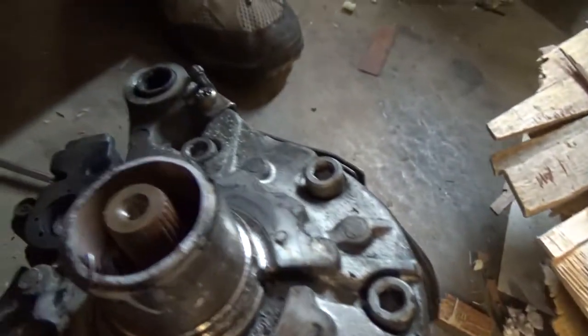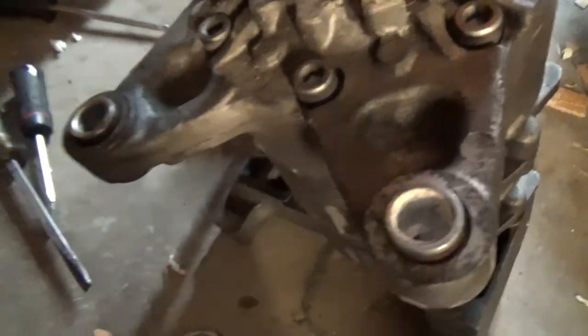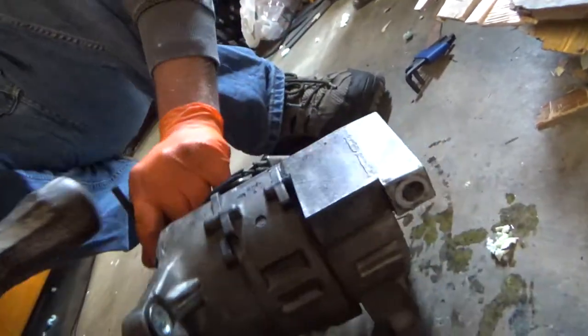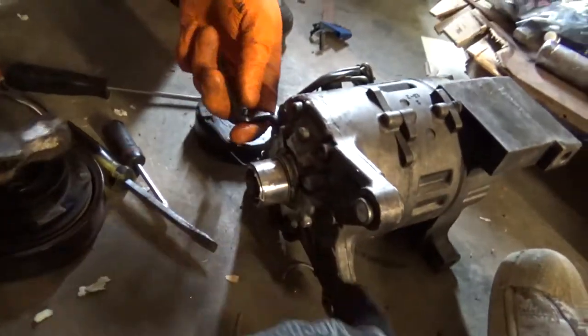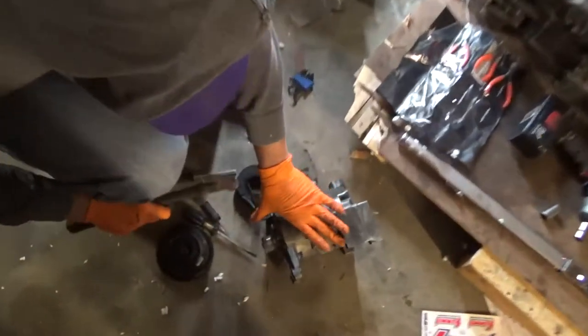Basically you need to take these Allen bolts off, and then these Phillips screws that hold sensors and stuff on, and then use this whole front housing. These Allens take this casing apart — it looks like a little mini piston engine in there. You want to use only this front housing and bolt it back on the engine to support the power steering pump, because if you don't, the power steering pump will flex and spin a belt, and you'll be wrecking into walls when you're drifting.